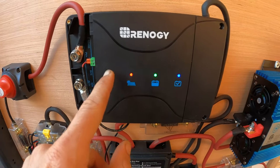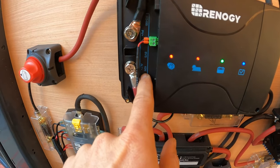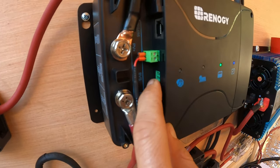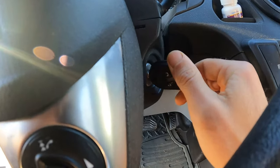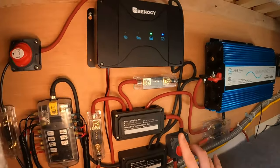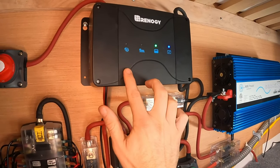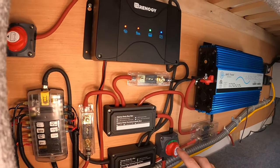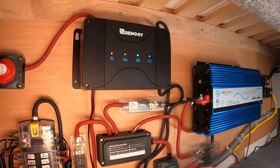Let's start the car and see if this red light turns solid. I don't have a smart alternator, so I didn't have to hook up the ignition alternator connection. I don't have a battery monitoring system hooked in here — I can always do that later. The charge controller is all hooked up and it's charging off the alternator now. We're charging our starting battery and floating power — battery is fully charged. I tested the alternator from the cord running through and it charges while we drive. Everything works.